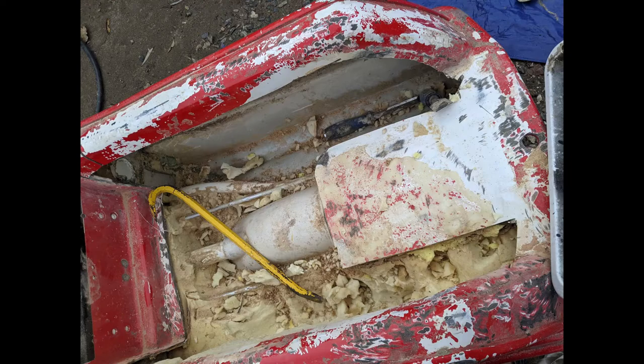It is a big process, not for the faint of heart. You have to basically grind out a whole section off of the back of your tray. You have to go along the footholds and avoid the pump area with your grinder, and don't go too far forward. Don't hit your exhaust pipe with the grinder. So there's a lot of things to look out for. That being said, I think everybody should do it.